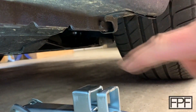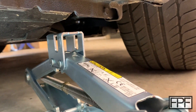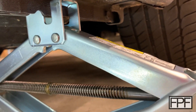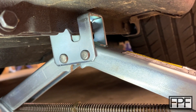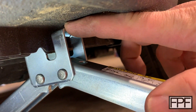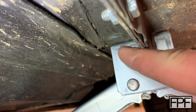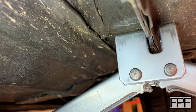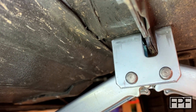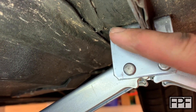Here's the factory jack. We're going to line up the jack and bring it up with that notch straddling the pinch weld, between those two notches. And this is where things got a little interesting. I've jacked up a car with the stock jack before but never really paid much attention to it. But you can see we're now lifting the car and the pinch weld is not actually hitting the jack — we've got probably five millimeters underneath that pinch weld to the jack. This plate here on the front isn't supported there either. But around back, there's actually a little metal pad that comes down a bit further, and that's where the jack is lifting the car. It's not lifting from the pinch weld at all — it's lifting from the area directly behind the pinch weld. You can see that pad on the left-hand side making contact with the vehicle and doing the lifting work.